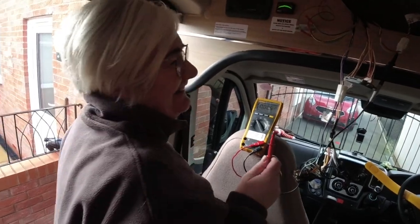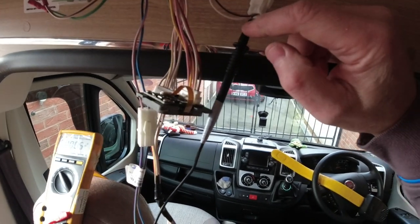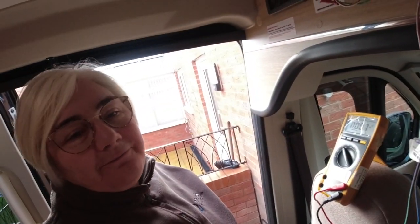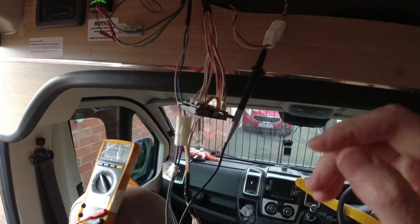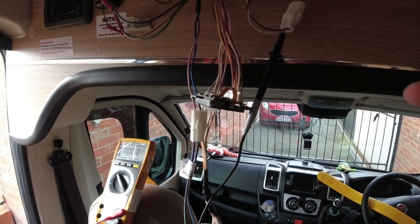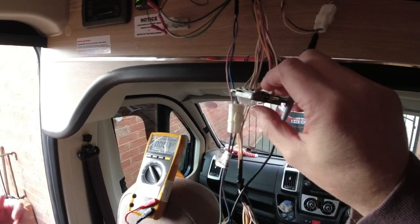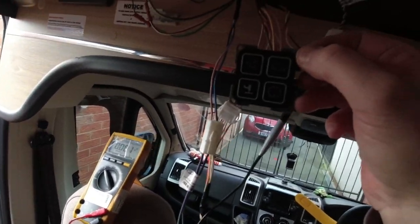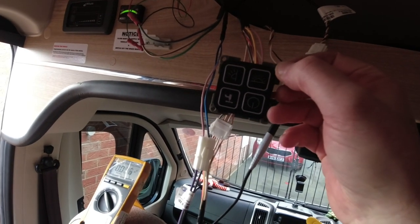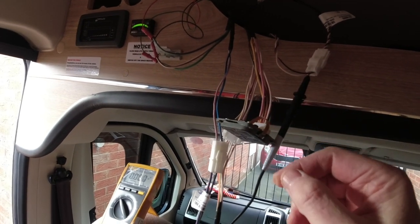After Brain Box has read the mass of snakes wiring: any solid white is what I would call earth, but you would call negative. So that's earth to me, which is what I need for one side of my light. And then we need to find a live which is turned on by the panel switch — see the panel switch there? That turns everything on. So we needed to find a live that only comes on when we turn that on.